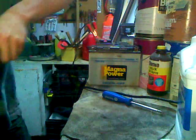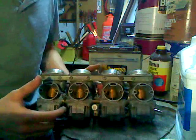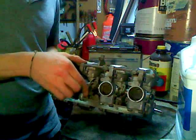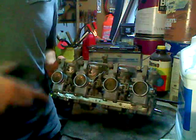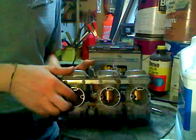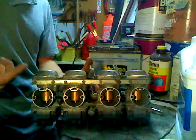If you're looking in here and wondering what in the world these are — I'm going to pull this tube up — they are actually called vacuum slides, and they're the secondary throttle plates. The primary throttle plates are here, which you manually open and shut, but these only create suction and pressure. So when that pressure occurs, it causes a vacuum up in these heads up here, which pulls this part up and allows fuel to run up the main jet.